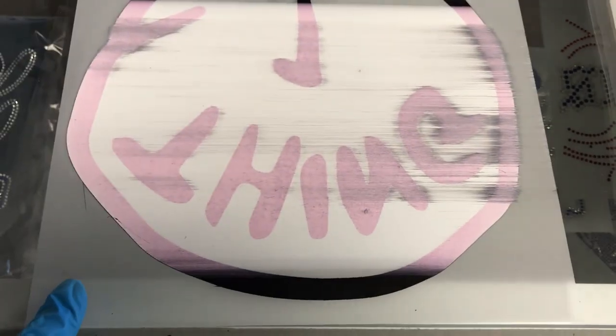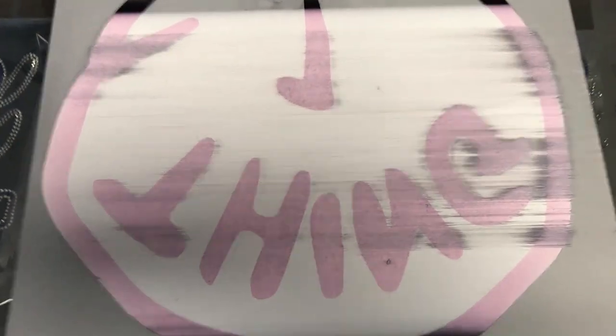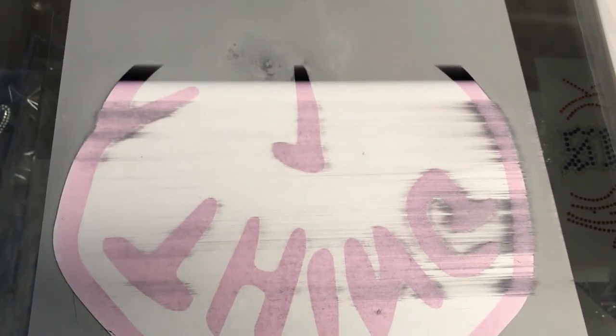So I've had that happen in the past, but the reason why I know these are head strikes is because you can see literally that's how the underside of the print head is going to look when we take it apart, more than likely. Well, at least the guard, it'll probably be a bunch of black gunk on the guard here. And so that will be the first step, and that's if you have vertical marks.